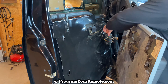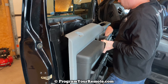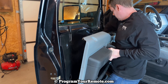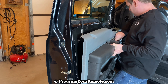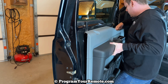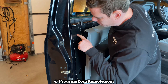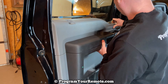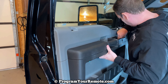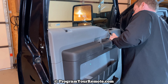To put it back on, we're going to reverse everything we just did. There are just a few things to keep in mind. We need to make sure that these wires are fed through so that after we get it back on, we can hook all that stuff back up. Go ahead and feed those through. You need to go in at an angle where these clips are a little bit above the hole, so that we're going to be able to go down on there. And the final thing to keep an eye on is the door lock actuator — line that up so it goes through that hole. Make sure your wires are pulled where they need to be.